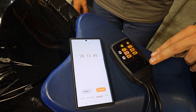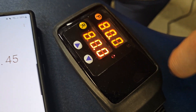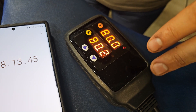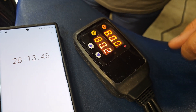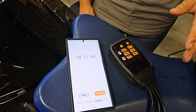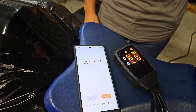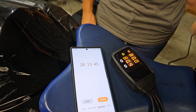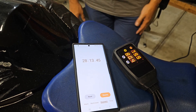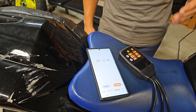28 minutes and 13 seconds. If you watch closely, the red light cycles on and off — that red light being on means the tire warmer is actively heating. They're set to plus or minus about 0.2 degrees and have a soft approach, so they come up, slow down as they get close, and then steady maintain the temperature. There you have it: 28 minutes 13 seconds from around 28 degrees Celsius up to 80 degrees Celsius.